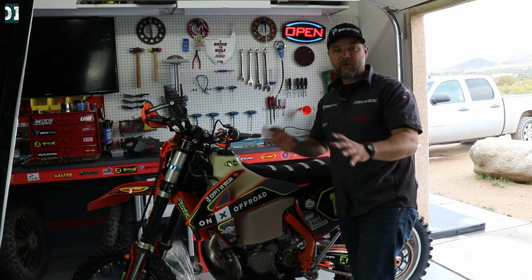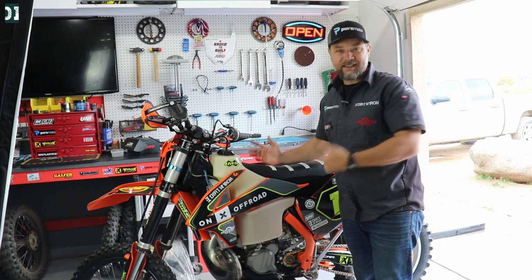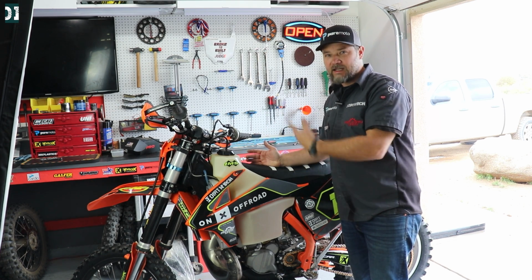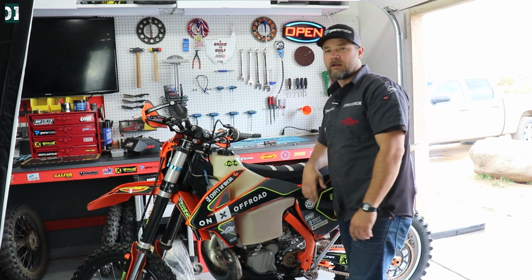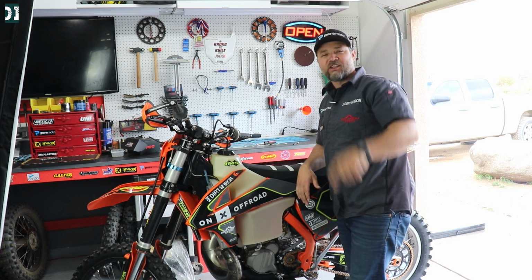All right, so we have to warm it up, go for a ride, and then we're gonna play with it a little bit. It started fine. I didn't need a choke. That's why it was a little bit harder, because I had the choke up. When I put choke back in, it started fine. It keeps idle. Let's warm it up, take it for a ride, see how it goes.